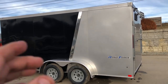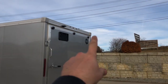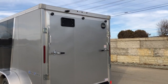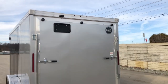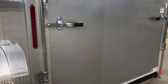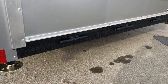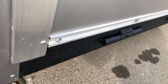This is a two-tone with a diagonal strip. Notice the strip pretty much splits your fender. It's also got cast corners at the rear for a nice clean look. The Road Force model has a couple of upgrades in and of itself — you'll notice the dual aluminum handles. A lot of times you'll see one plastic or maybe one aluminum, but this has dual aluminum handles. Also notice the rear ramp door is all trimmed out in aluminum. You'll see a lot that leave that exposed steel. Notice three hinges on the ramp door instead of two, and there are grease zerks on the hinges. Also notice the Armor Guard on the rear sill as well — so not only up front but also in the back.